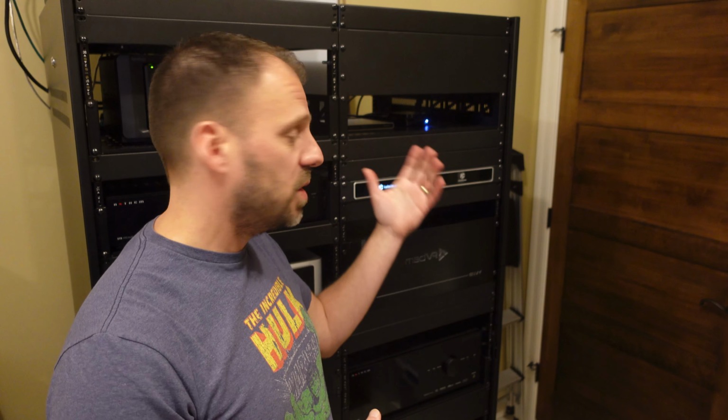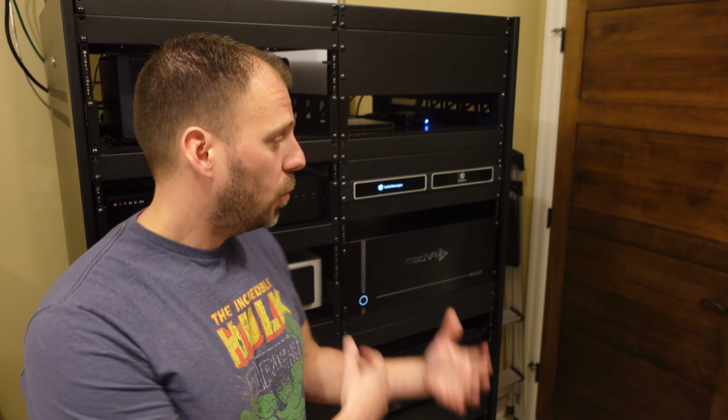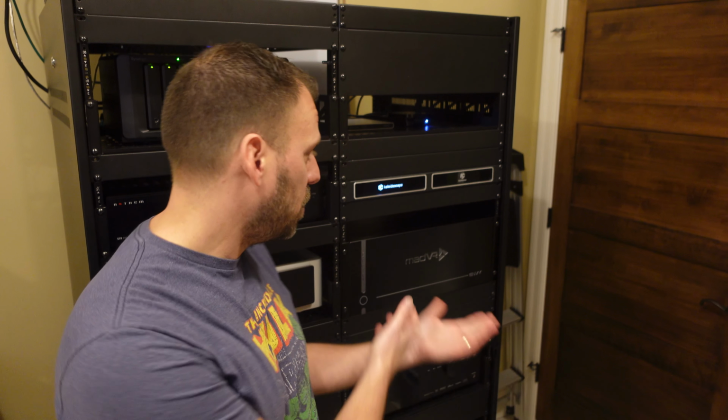When I'm watching video sources like the Apple TV or Kaleidoscape, I would have my system configured to put the projector on HDMI 1. When I'm using a gaming source like that PlayStation or PC, I would configure my system to put the projector into HDMI 2. And I would very deliberately in the projector then have a pretty significant difference in terms of setup, settings, and configurations between the two. HDMI 1 would be completely and properly set up to engage with the Envy doing all of that video processing, heavy lifting work. And HDMI 2 would be relying solely on the projector to do its processing. We would want to make sure that the projector is in its low latency game modes and other things like that.